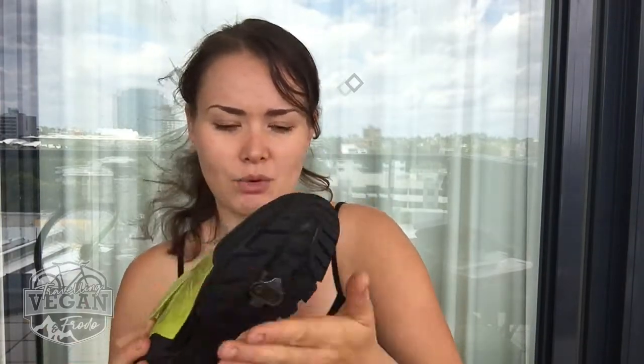The cleats come with the pedal and you just screw them on with a couple of bolts on your shoe. Make sure they're evenly placed and the same on both shoes if you're doing it yourself at home — see how comfortable it is and what feels good after riding for a while. I actually had to adjust my cleats about a third of the way into my American ride because I was starting to feel pain in one foot while the other was fine. The cleats weren't completely aligned. When you put them in yourself, they should be in the ball of your foot and in the middle, then you see what's comfortable for you to pedal.